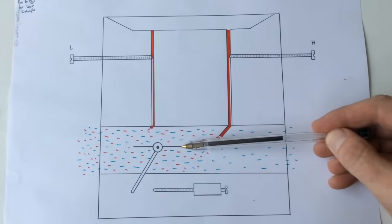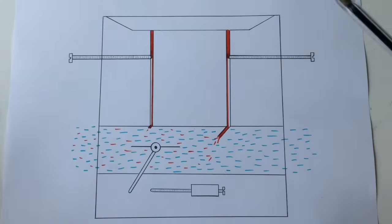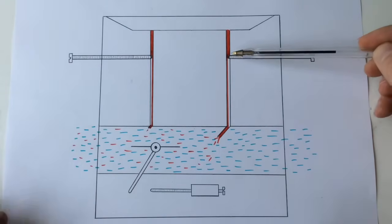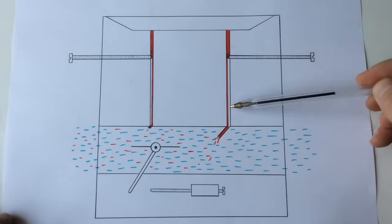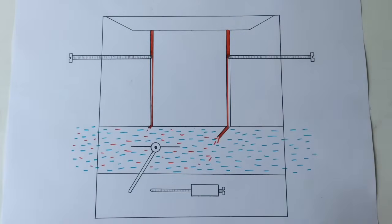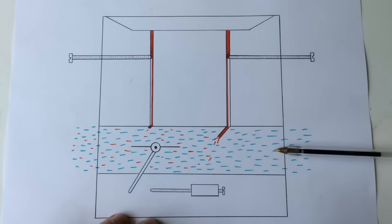This is how we do it - work on the H first to get the high revs right, because we've still got full throttle open, holding that with a finger. Now if we start to go too lean and screw that screw in too much, we can see we're blocking it off and going lean - we've got less fuel coming down.